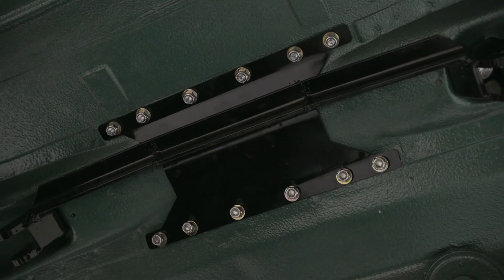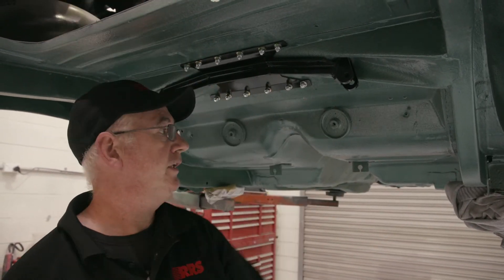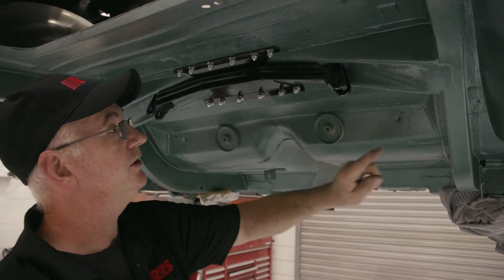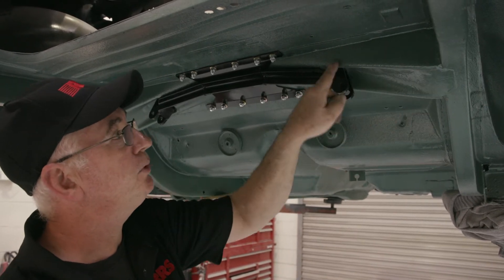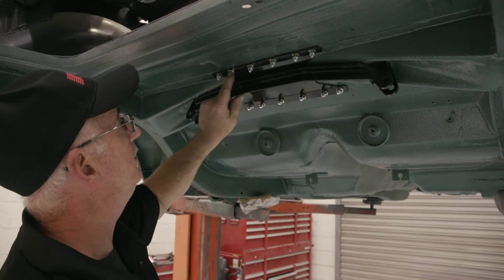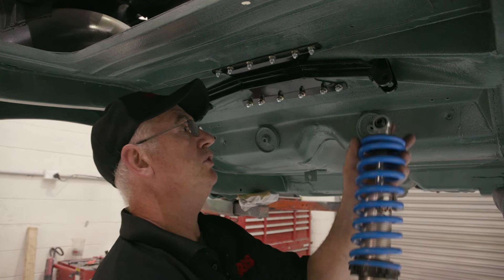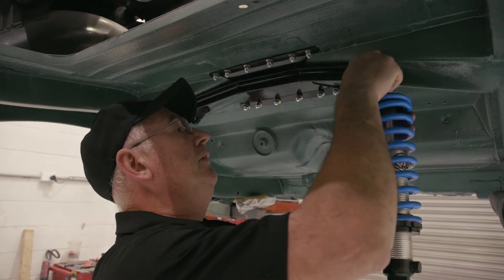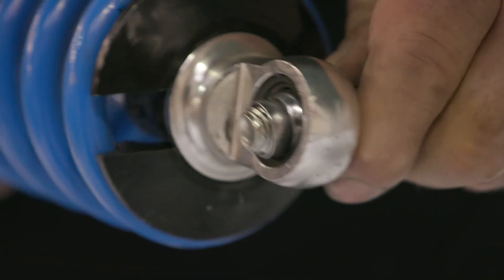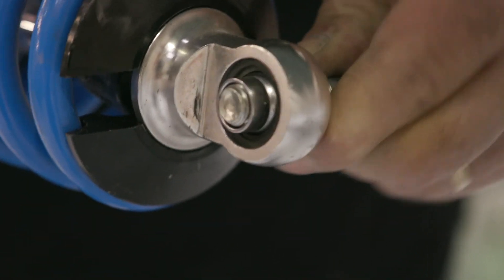The whole thing becomes a reinforced structure. Normally the load bearing of the weight of the vehicle is through the chassis rails at this point and at the end of the shackle mount. So now it's been relocated to here, and it has to spread its load into the chassis rails. This pressing is more than adequate, but this part in this area is not adequate enough — that's why it needs this reinforcement and the load spread fitted to the inside. Once everything is bolted up, you can hang the shock absorbers ready to mount the diff. Here is the Johnny joint that allows free articulation — this decreases the load put on the mounting location so it's not twisting it. It's very important to allow enough compliance in all of the components so there's no bind in anything.